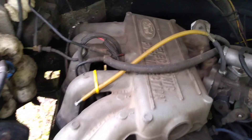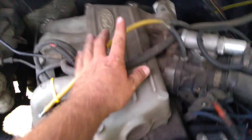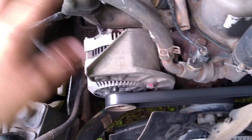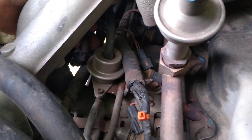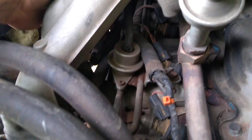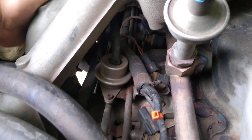Vacuum lines. So first off, this little guy right here — there's a valve right here that's called a purge valve. Don't need that, I deleted the EGR system so I don't need it anyway. See that guy right there? That's the plug for the bottom of the purge valve. That's just sitting in there, don't need that.